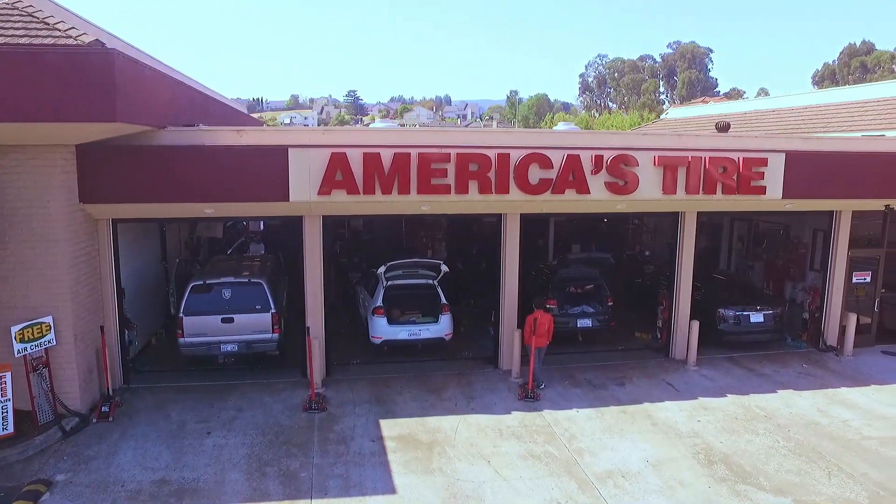When you go up to the 21-inch — or 22-inch on the Model X — that's more for the spirited driver. The shorter sidewall gives you better handling and performance, but the downside is the tires wear out a little bit faster. If you hit a pothole or a bump, there's less rubber to absorb it, so sidewall bubbles and impact damage are more common. And with the larger sizes, you will have to replace them more often.